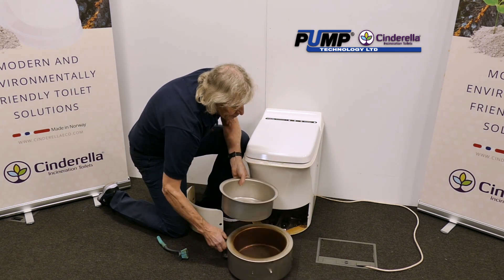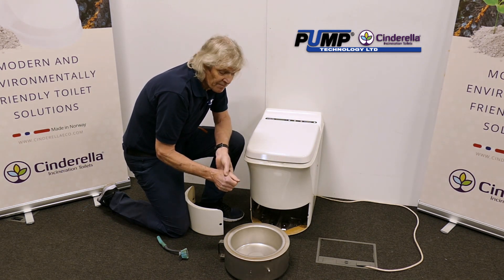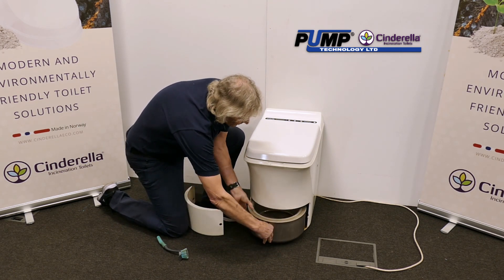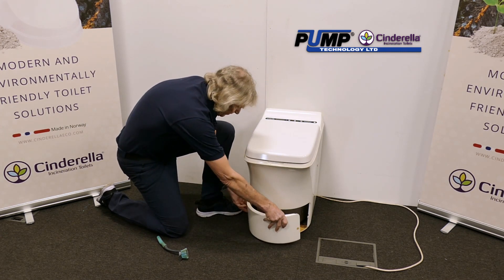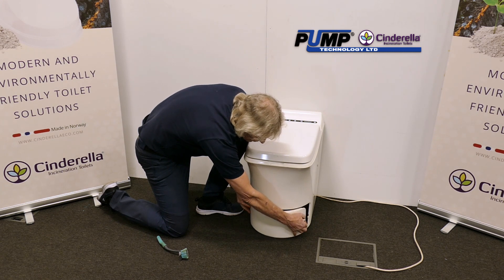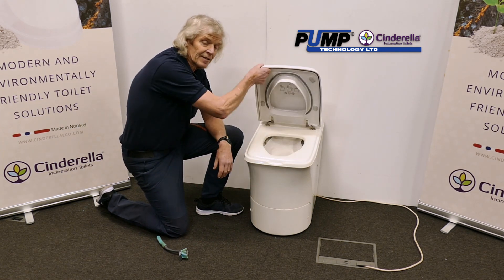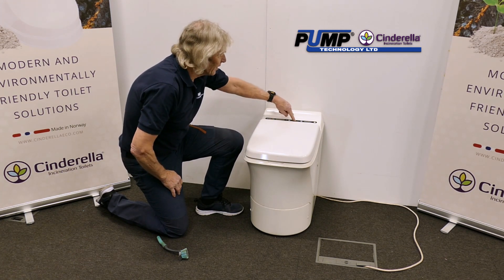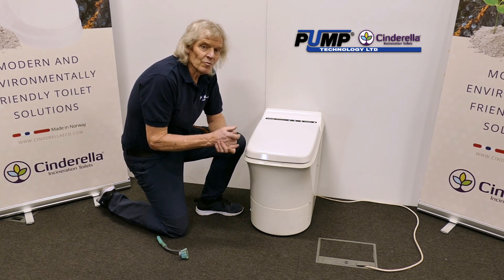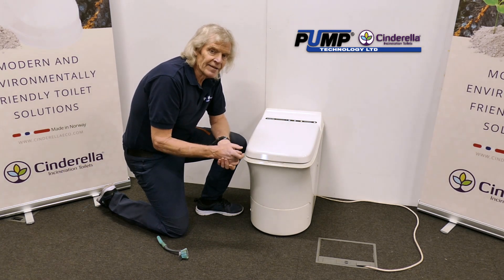Put the insert back into the container. If you wish, you can do a steam clean — it's worth doing this every couple of months. Just get hot water from the kettle, put in about a pint or two pints of water, replace the cover, then lift the lid, put it down, and hear the fan start and put it through a burn cycle. The water inside the insert will get superheated and that superheated steam will go to the catalytic converter, through the fan, and basically clean everything.